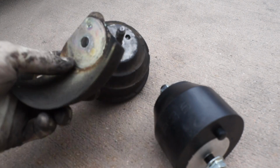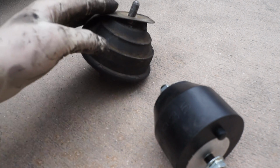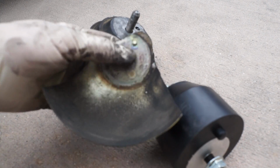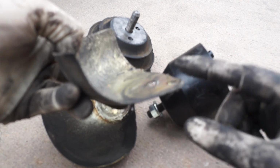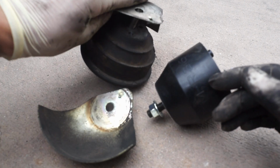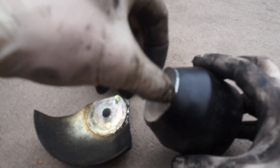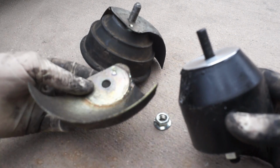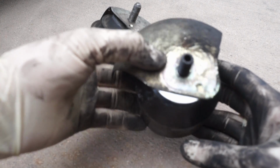Now one thing to note is that the exhaust side has this little heat shield here, and so that guy is going to sort of sit on the mount like that to protect it from the exhaust. So I'm going to be reusing this. It looks like this little dowel thing is broken off on this one or got bent. So here's the other one. This is off my other M3, and you've noticed it has like this little dowel pin right there that'll line it up on these holes on the engine mount. Now, yeah, sort of sit like that. Now on this mount, this new poly mount does not have a little spot for that, which is perfect because this one doesn't have that little pin there. But if you do, and I highly recommend you do run these again, if you've got a mount that doesn't have a spot like that, you can just sort of break it off, and then that guy will just sort of sit on like that.